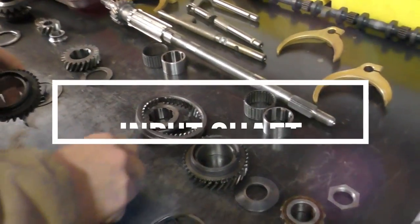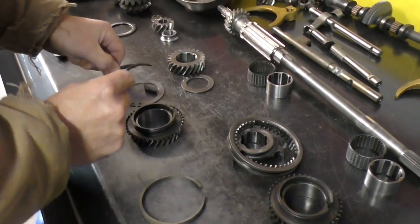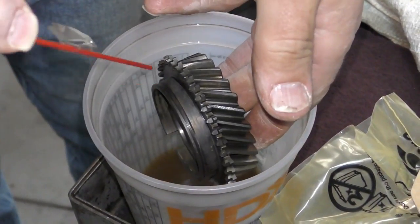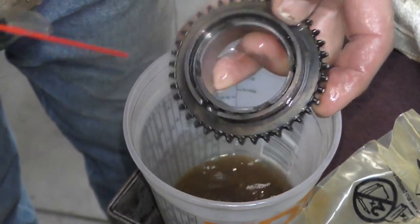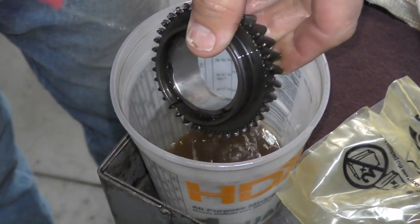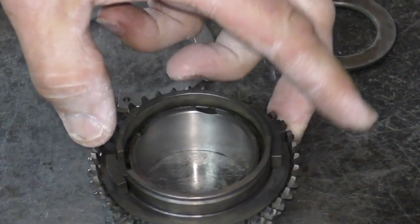The first thing I'm going to do is assemble our gear sets — putting in our anchor blocks and energizer rings, and replacing our old synchro rings with new ones. I'm just getting my final traces of any oil out of the system. Even though it's been through the parts washer, the brake clean evaporative cleaner I like to use is kind of my final assembly prep. I'm going to start by assembling my anchor blocks onto my gear — this little anchor block sits in on the bottom one, and the other one floats at the top.